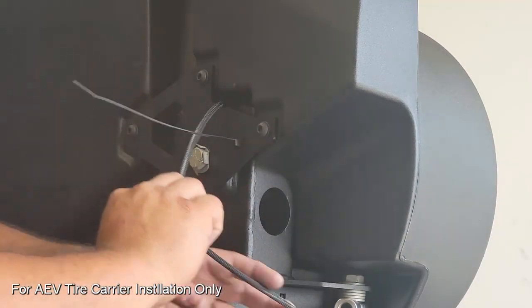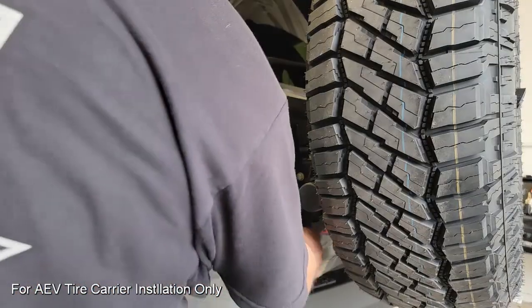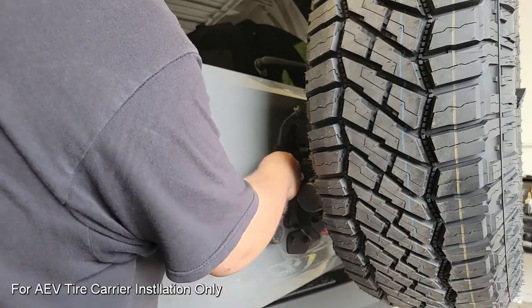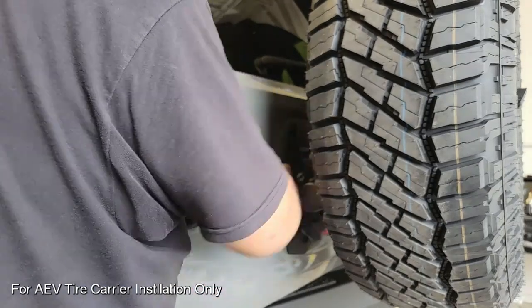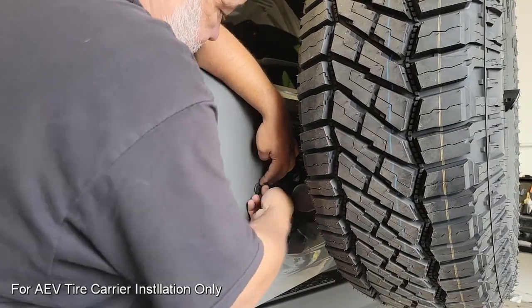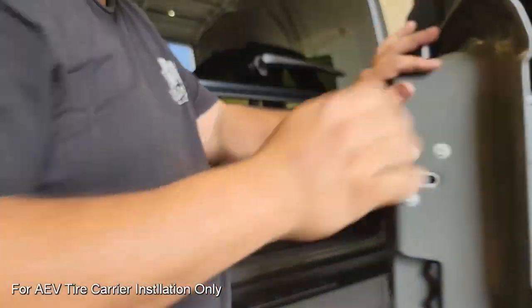Lastly, we got to clean up our wiring here. A zip tie through the appropriate hole will allow us to get this tucked back into where it needs to be. With the turnbuckle back in place, we can do the final wiring here and get the harness tucked away where it needs to be, and of course pushing the end leads back into the tailgate so we can get those wired up to the factory harness. You're going to want to make sure you get a nice firm seal on this and that there's no issue with the rubber fitting, otherwise we're going to have leakage problems there.